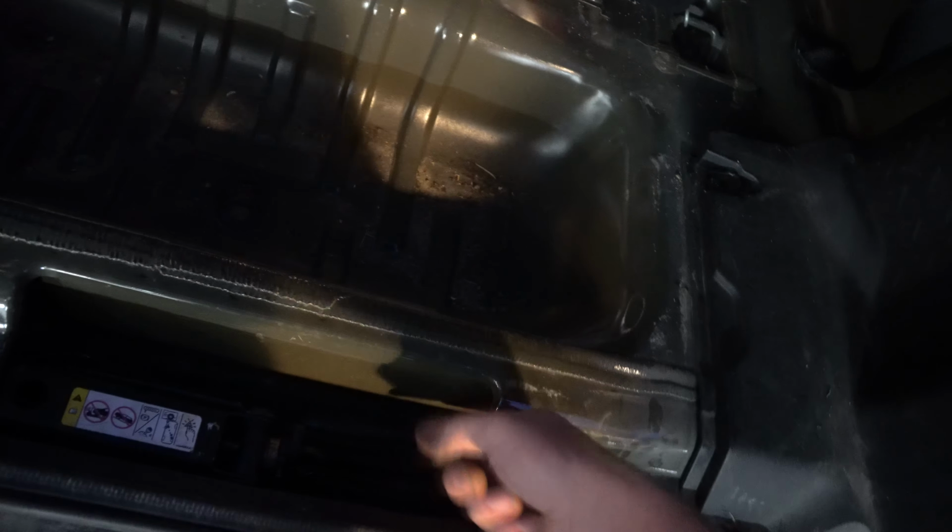So within this compartment here, there's a rubber grommet. From right here, there's another rubber grommet right here. I wouldn't suggest going here because usually your exhaust is sitting right here. So you might want to take it from the one that's over under here. I might have to remove my jack, but right in this small compartment here, if you move your jack stuff, you'll see another rubber plug. We'll put a small cut in that and then pull our wire up and through, and that'll wire up and into here, which will be going around and over here.